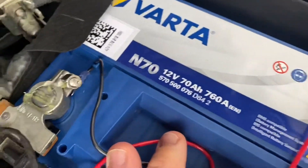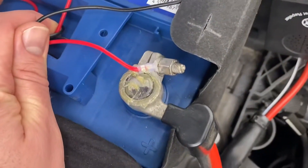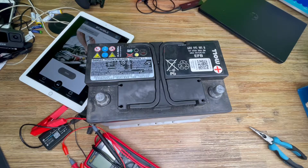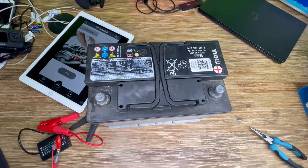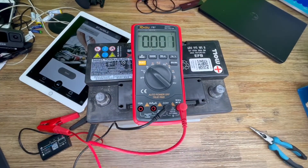EFB is an awesome thing. New starter battery technologies extend the range available, but also make it difficult for us to find the right replacement battery for the vehicle. If you have a built-in AGM or EFB battery, you can replace it with the same type. It is not good to replace it with an old conventional flooded battery. And furthermore, if an EFB is built in and you want to go to an AGM, you have to relearn it using a separate scanner on your battery power management system.